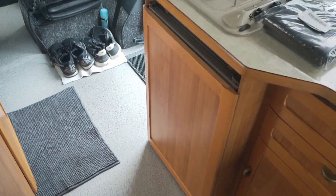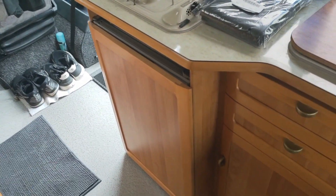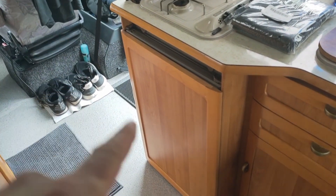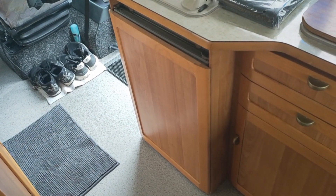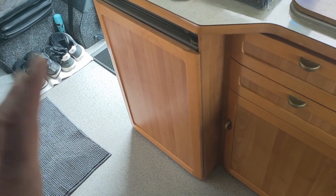Now a very important topic: the fridge — the absorption fridge. I showed it in the other video. I took it out, put it upside down, and left it like that for a week. Usually they say you just need to leave it upside down for a day or so. I also changed the thermal paste behind the heat sink. The reason you do this is if you have an older Hymer and your absorption fridge isn't cooling down properly — take the fridge out, put it upside down, apply new thermal paste behind the heat sink, and that should help fix it. Mine works awesome now.